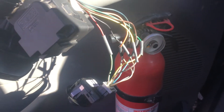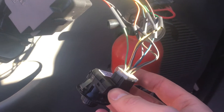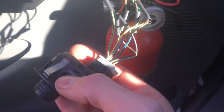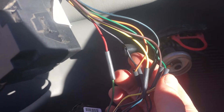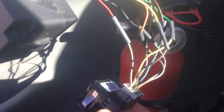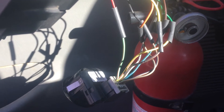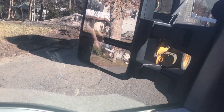For the mirror control switch, I took my new switch and used diagrams — I'll post pictures of those. I repinned and rerouted the wires. I took a new-style connector from a donor truck, soldered it to the old harness, and repinned it according to the diagram. The only issue is that the left and right controls are reversed because the newer mirrors have reversed motor directions. Up and down work fine though.